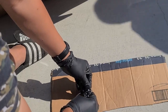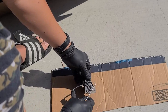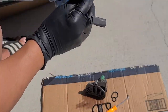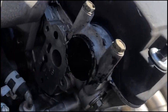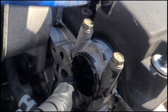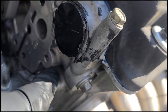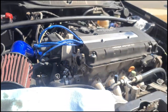As I suspected, I needed to use a pick. Be careful using the pick — you don't want to mar anything when removing the rubber gasket. I'm using brake cleaner to remove all the oil and checking the surfaces to make sure they're nice and even before I start to sand. Since I got the VTEC solenoid off, I can see the cam seal a lot better. They really put a lot of RTV on it, and I didn't see any noticeable leaks there, so hopefully we're good on that one.